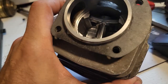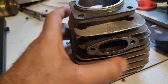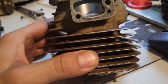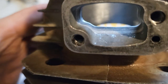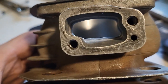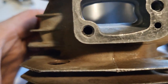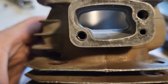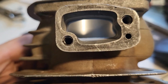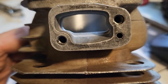This is a 181 cylinder that's going to be the race top end for that saw one day. Here you can kind of see — I don't think this is slanted quite as bad as the 288 — but you can definitely see where the roof tilts down and the floor stays flat. That's really what I was talking about with moving the intake roof.